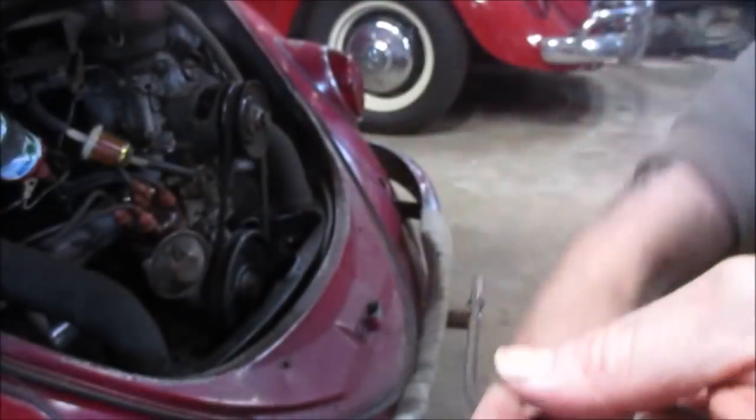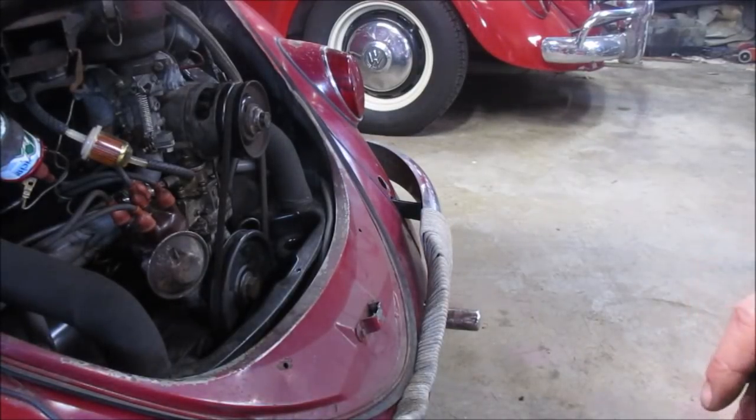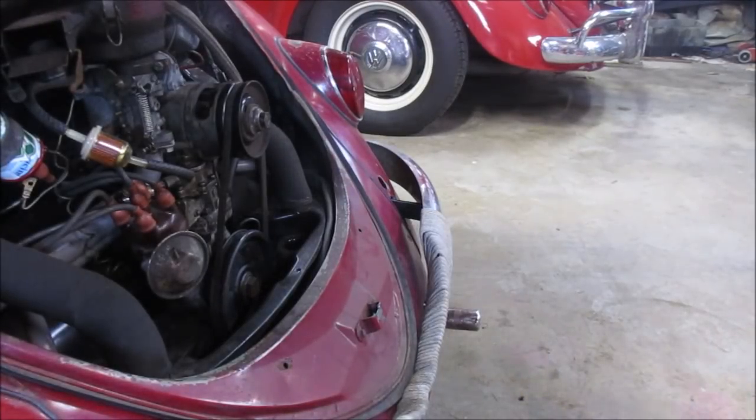So that was my concern, that I was having an intermittent idle problem that was not consistent. And not only was it not consistent, it would not adjust with the idle adjustment screw. That usually has been my experience, and would lead me to believe that there is a vacuum leak somewhere. Sometimes I've found that it could be in the base gasket. I found it there. And other times I have found it right here in this vacuum advance. And in the case of this one in particular, it appears as though it was in the vacuum advance. I don't know for sure, but we are definitely going to put a fresh set of hose on there that fits real nice, and fire this car up and see if it doesn't make a difference.